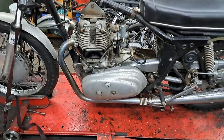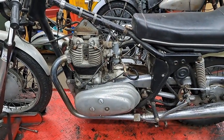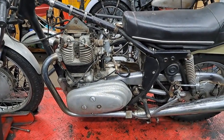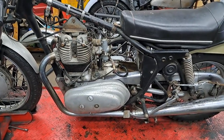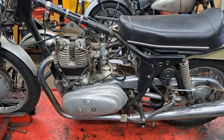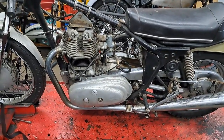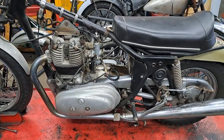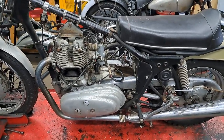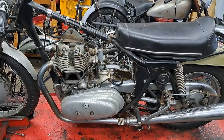So anyway, like I said, I'll tap those valves and make sure they're operating properly. Run the engine through a cycle on that sort of thing. Not run it, but turn it over. I'll put a little bit of oil down the spark plug holes to make sure the cylinder's well lubricated, and then we'll stick a compression gauge in there and see what I can come up with.